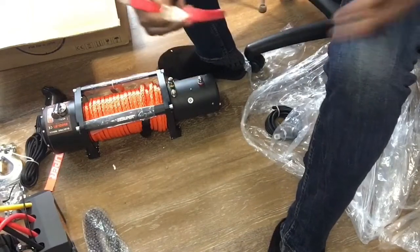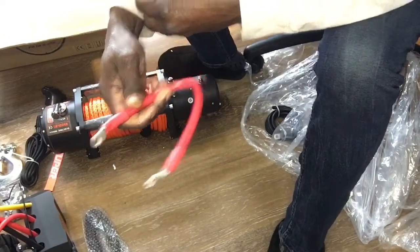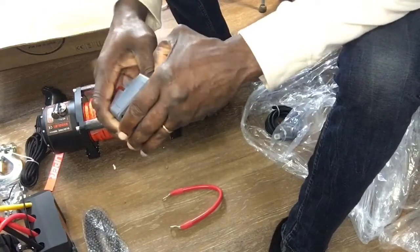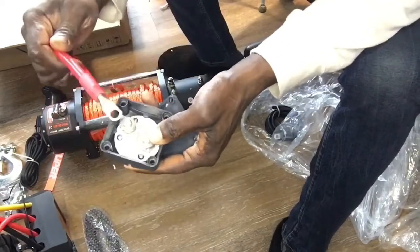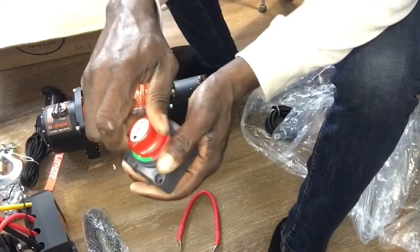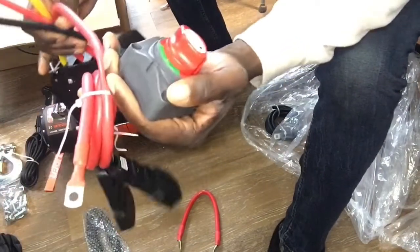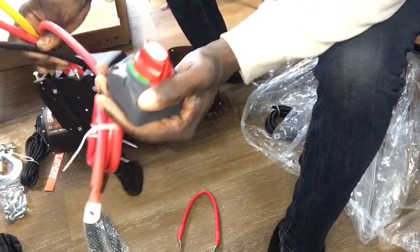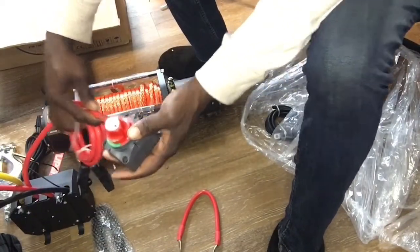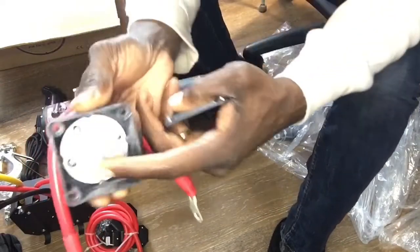So what I'm going to do is, I purchased this off of eBay. I purchased a 2-gauge positive 12-inch cable, and also purchased this shut-off switch. So pretty simple, pretty straightforward. You just connect your wires inside here, and that will give you the ability to turn on or turn off power as you need it. So what I'm going to do is, between the positive cable that will route back to the battery, instead of connecting this straight up to the battery, this will route into here, and then this short one will connect to the other lead on the inside of there.